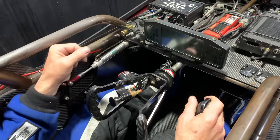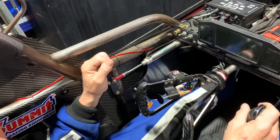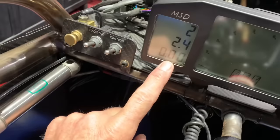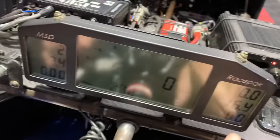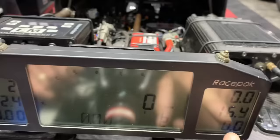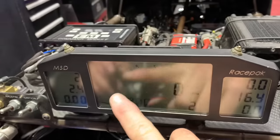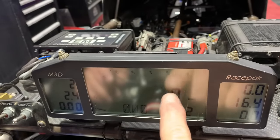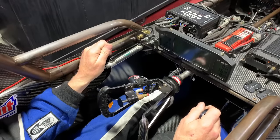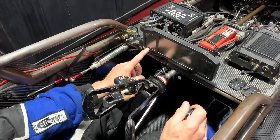When I hear it start, I'll use this fuel pump lever to turn the fuel all the way on. That's when you'll see all the smoke start coming out and all the stinkiness that is nitro. Once it's fully running on nitro, I will look at the dash. This number right here is fuel flow, this is fuel pressure, and on this side of the dash is oil pressure — three important numbers I look at. The other side of the dash is timing of the mags, but there's nothing that can be done about it. In the center it has a sweep gauge of RPM. Once the car is running fully on nitro, I will trim this back, looking at these numbers on the dash, and set the fuel flow number according to what the crew chief wants. We adjust that according to whether it's hot or cold outside.